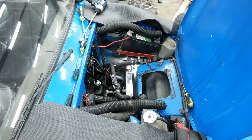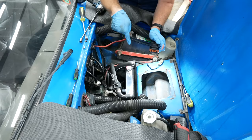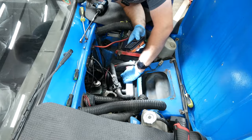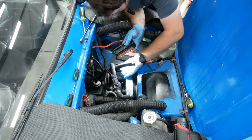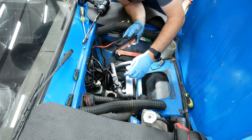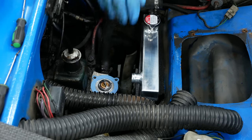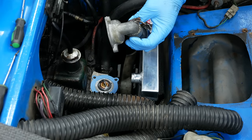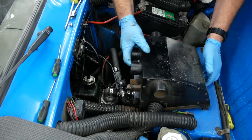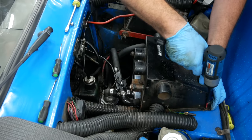There's three screws on that side and only one screw on this side — it's barely held in place. But you've got to remember, the other radiator was not held in place by any screws whatsoever, so this is an improvement. Nothing is rubbing, including the radiator hose — again, an improvement over before. The fan clears. Let's get the upper radiator hose, thermostat, and housing all back in. 75-degree thermostat, gasket — do I trust this gasket by itself or should I use silicone? I'm just going to go with it. Thermostat housing — I put this through an ultrasonic bath; it was unbelievably filthy. I'm going to put the heater core back. Don't have to worry about the fan working because it doesn't.